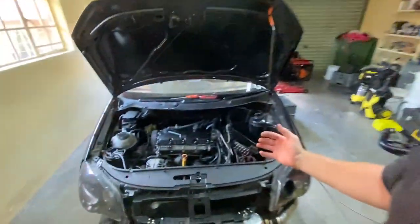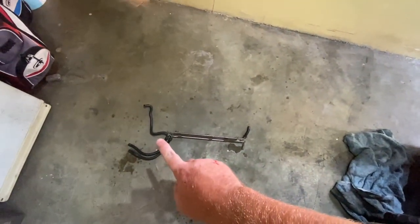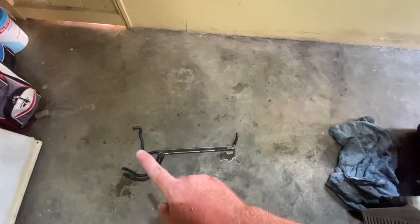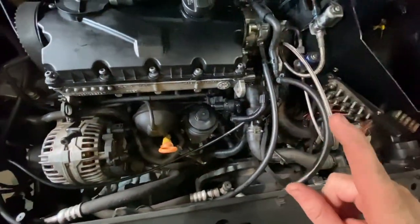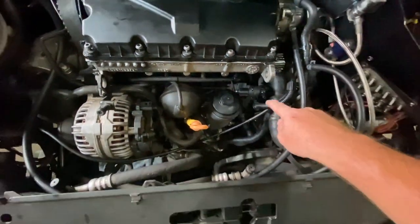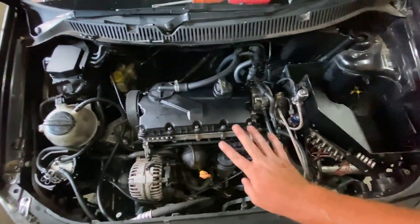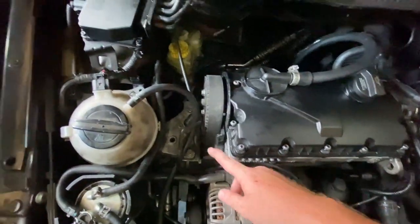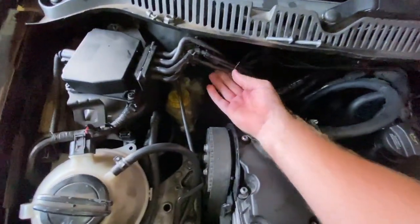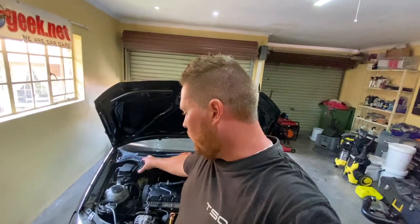For those of you who don't know what I just did — as you can see I took off these fuel lines. Two is fuel, one is supply, one is return, and one is water. As expected I didn't get enough — that one still needs a line, so I'm going to need one more meter. This is where I ran it now. I'll tidy this up once the other one is in, then put all three together. But overall it's a much cleaner look. The N75 will cancel all of this — all these lines. I cable-tied all of these together, and one goes to the actuator, which is the only one I'm using at the moment. If I put an N75 valve, that's going to clean it up a lot more as well.